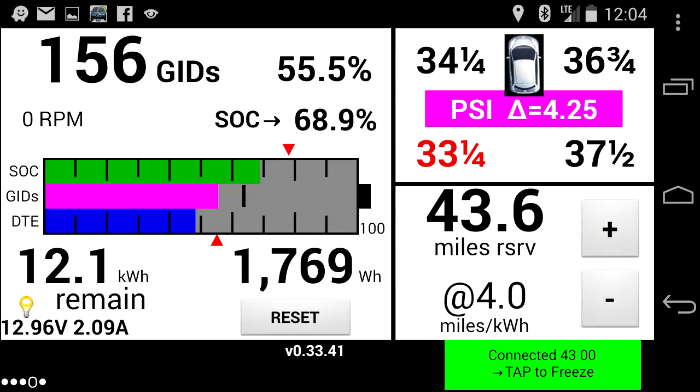However, it's not completely automatic — it does need to be set up. As you can see in this picture, it looks like the rear left tire is a bit low. But I haven't set this up yet, so you need to know that those sensors are just kind of assigned to each tire. LeafSpy does not know what tire is actually on which sensor, so you need to figure out which tire corresponds with which sensor.